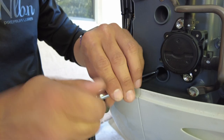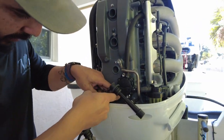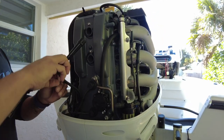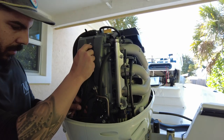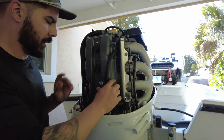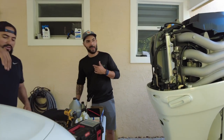All right, I'm assuming you don't want these old ones. Since it's inline, one is shorter than the other, so it's very simple. Make sure they make contact. All right, spark plugs are done. That was quick — that's probably the easiest thing to do. I like doing it from easiest to hardest.